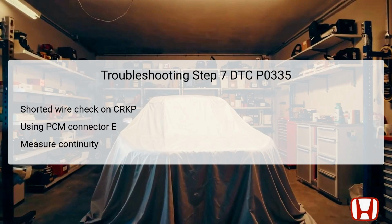As with previous steps, begin by switching the vehicle to off, lock mode. Then jump the SCS line through the HDS and wait for a duration of more than 1 minute to stabilize the readings. Disconnect the PCM connector E, ADP, yet again to ensure proper electrical isolation.